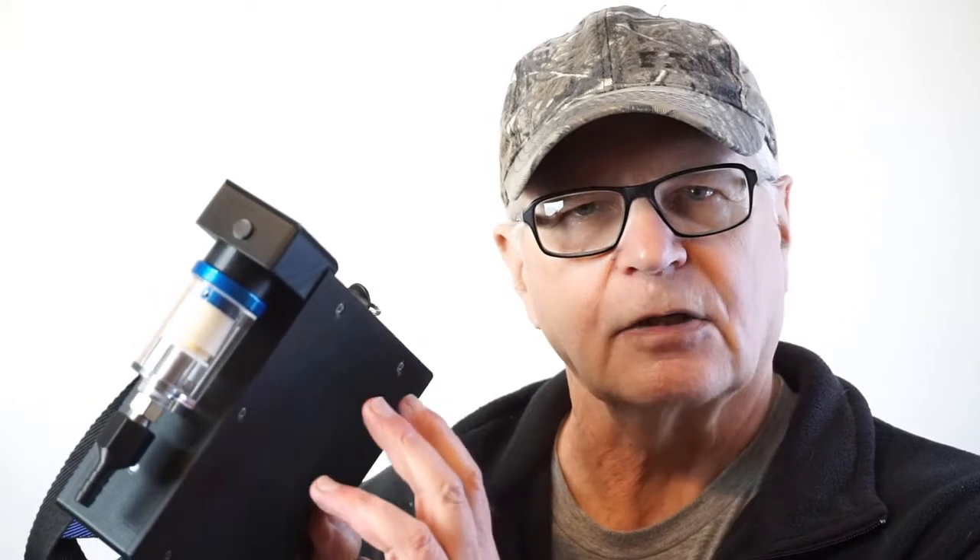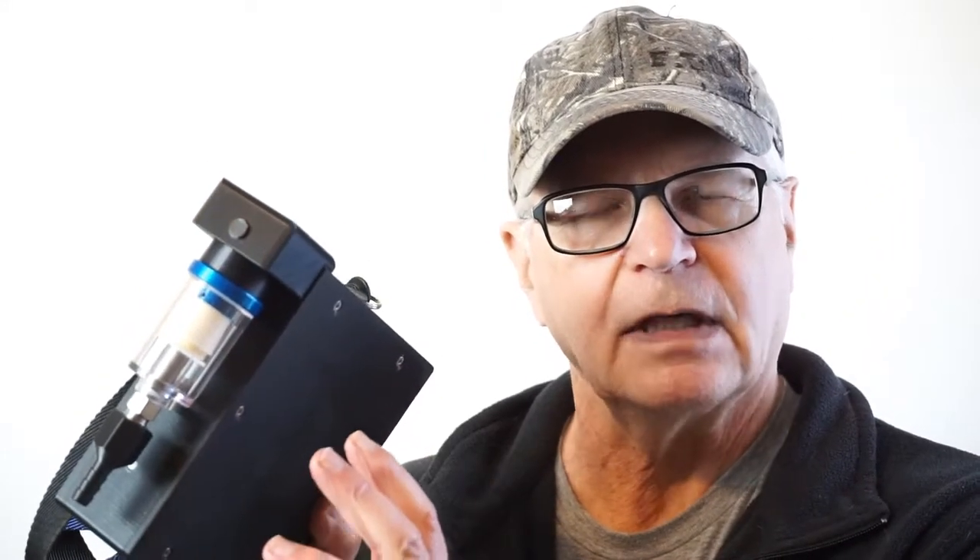It's not every day that you'll see a Bluetooth gas analyzer. Through the Android device it's also Wi-Fi, so it's connected to the internet. The files generated can be saved, shared, emailed, sent through social media to Google Drive. The MQ-2 and MQ-4 have been calibrated and added to the HCODE database. Over the next few weeks to months, I'm hoping to add some of those MQ-X sensors — maybe the MQ-7 and MQ-9, which are intriguing for their carbon monoxide detection. If they pan out, a request will be made to have them added to the HCODE database.